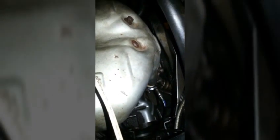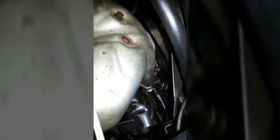On this exhaust shield, there appears to only be four bolts holding it unless you're really paying attention — these ones hide a little bit more. There's one on this side and one just on the other side as well. Something Brian's Mobile One taught me: if a part's not coming off, give it a little wiggle and often it'll point you where you're going. Since I've settled that into a habit, that bolt was easily found last time I did this job a year ago.